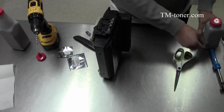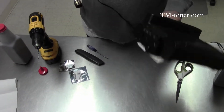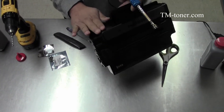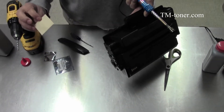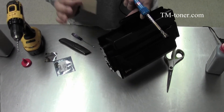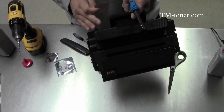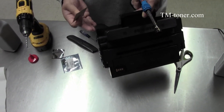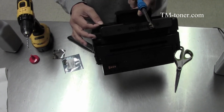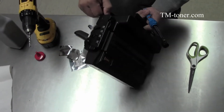The first method is if you have the hole-making tool: make the hole right here and then refill the cartridge. After it's done, put the seal tape to seal the hole. That is the way I do it, because I refill a lot — I have to refill this cartridge almost once a week. So this way is easier to refill later on.